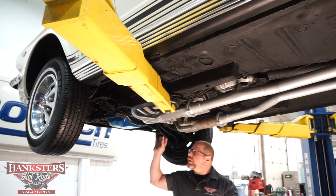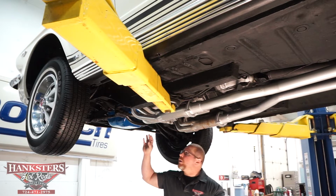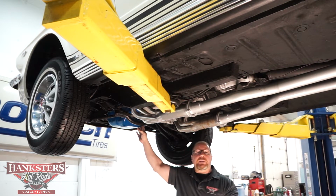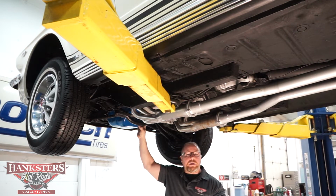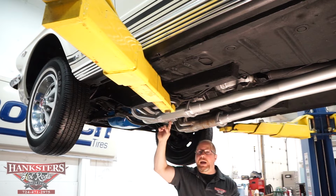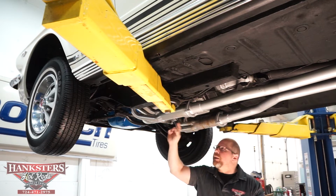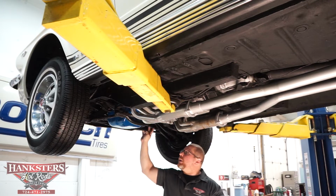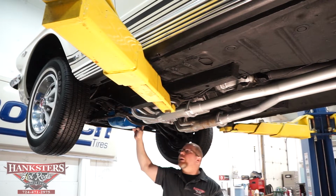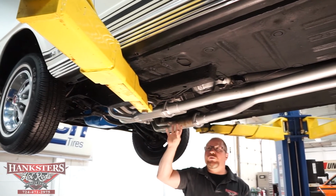As far as the drive line, since we're standing right underneath the motor and transmission here, the motor itself, I believe, after decoding everything, is a '72 302 cubic inch small block Ford. Right behind that, we have a C5 automatic transmission. Now on this transmission, the pan and the pan on the motor, as I look around those, these look free from any leaks or drips.